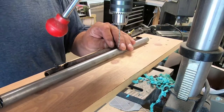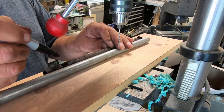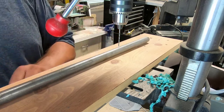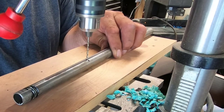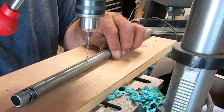Now I take the old burner and set it next to the new burner so I know where to start drilling my flame holes. I'm using a 3/32 inch drill bit to drill the holes for the flames. These are a little bit bigger than the 1/16 inch holes on the existing burner, but it shouldn't hurt anything. Now I'll start drilling the holes. I'm going to drill them roughly about a quarter inch apart and I'm going to stop about one inch from the end of the tube.